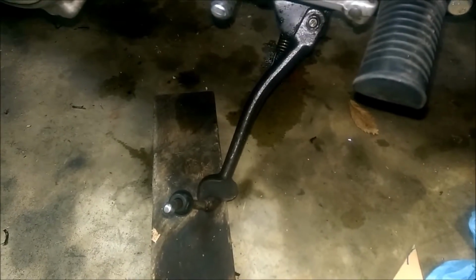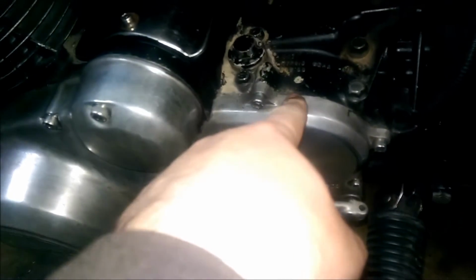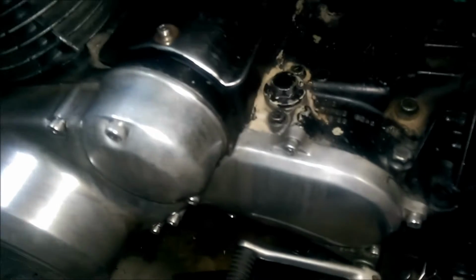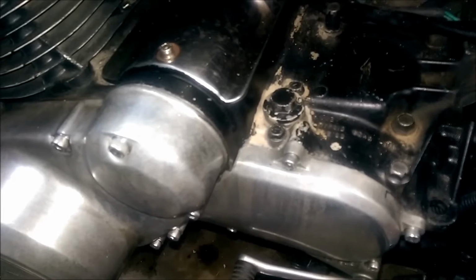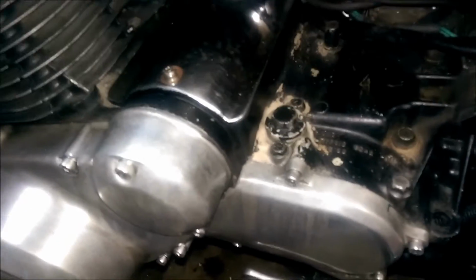I have had a little bit of gear oil coming out when I ride. When I go riding, I park and of course pull it back in here and park. A little bit of gear oil, but I think it's because we might have overfilled this when we did it, because there's no filling amount marked on here like the other side, and I didn't really look it up. We just kind of filled it up to a certain point, but now when I opened it up, it's completely up to the top. You can't see anywhere around where this drops out into the gears or whatever. You can't see anything, so I really think it's probably overfilled, and it'll probably quit dripping once it's down to the point it needs to be, so I may not do anything at all with it.